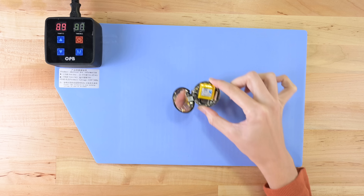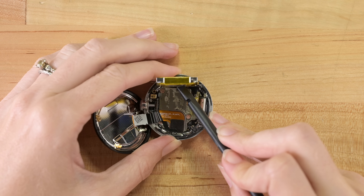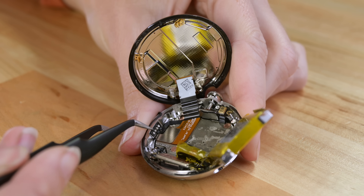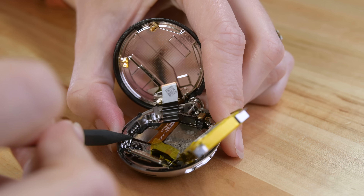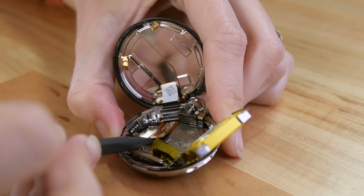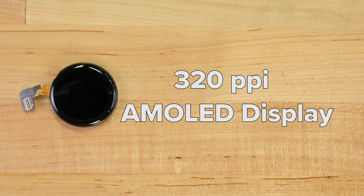Tiny contact pieces. A little heat and prying — not great for a soft battery pouch — and it lifts out to reveal a tiny cable secured by a bracket. The display connector is finally accessible, nestled under this test port cable. Luckily the display cable pops right out, which is a good thing since this port seems pretty stuck in the case. Nothing much to see on this display, so let's get back to the battery.